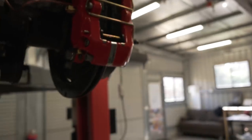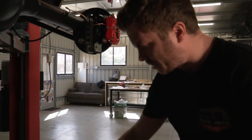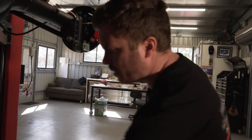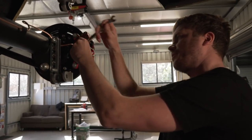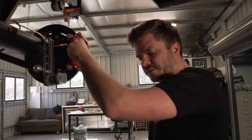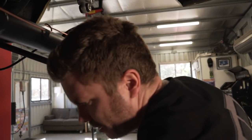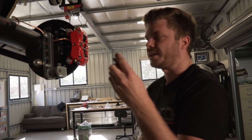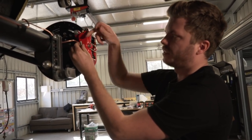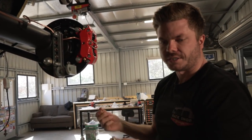Professionals. So, we got some fittings now. I did have a spanner for it. We got these fittings basically like an adapter because apparently, talking to the brake guy that I just went and visited, this is a gas type thread. So it accepts this and it's a tapered thread. We got these from Casimir Rod Shop, which would then bolt into there, and then we'd have to get a fitting to that, but we don't have any of those fittings that would actually fit.